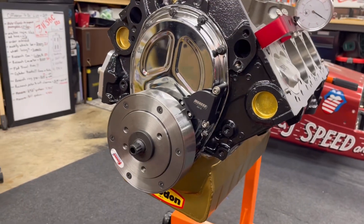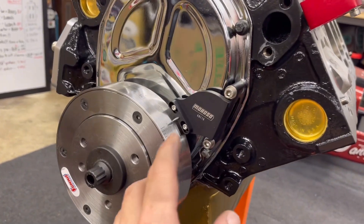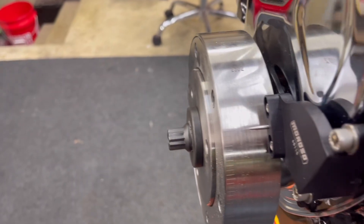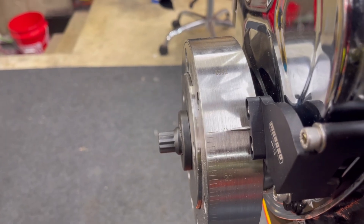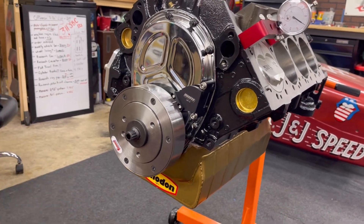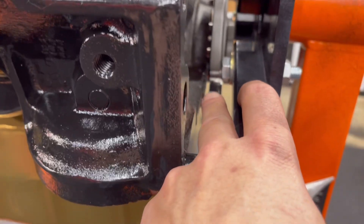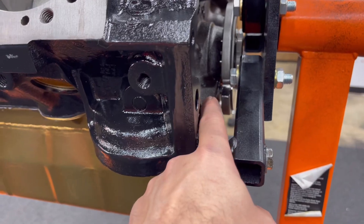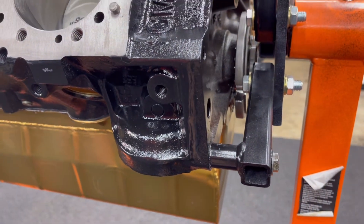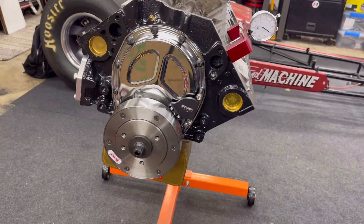There we have it — not too bad of a job to do. At the end I put this at top dead center and installed an adjusting timing tab by Moroso, lined up right at zero degrees. Not too shabby. Right tools matter — to keep this thing from moving I have a tool I made that I put in between the keyway flange on the crankshaft to hold everything in place, since it does require a little bit of force. Harmonic balancer is installed.